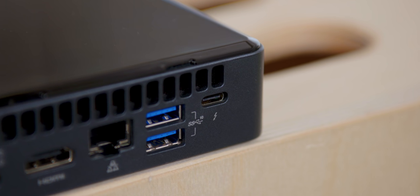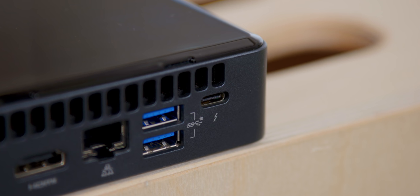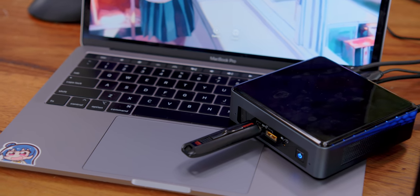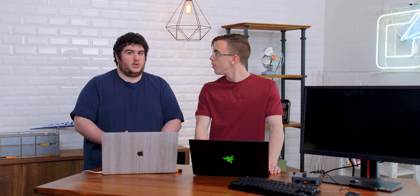The important thing is we can actually hook up an external GPU to this guy, so in theory we're getting iMac-level performance for a third of the price. One thing you do need — unless things have changed — is a Mac to do a lot of the setup. So you have to have an existing Mac, which we have here, then you'll prep it with something called UniBeast, which will create a bootable USB drive, as well as handle some configuration things.